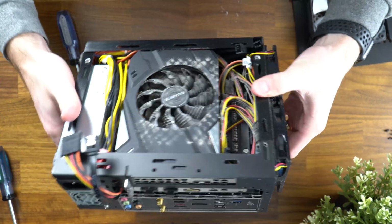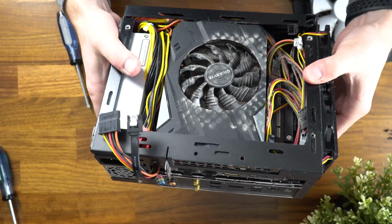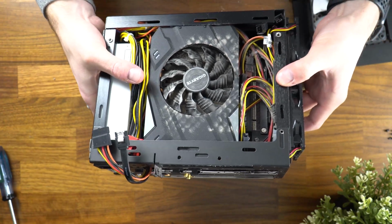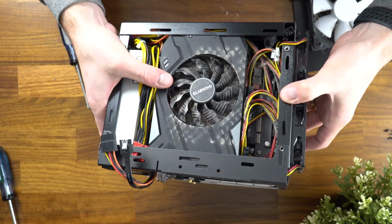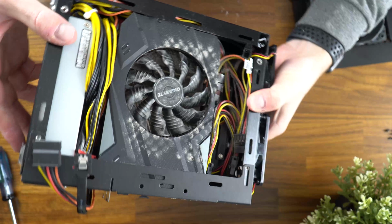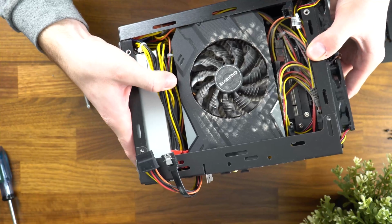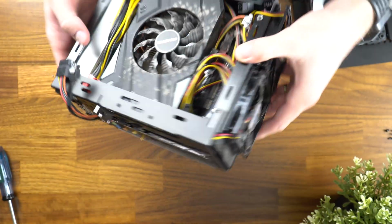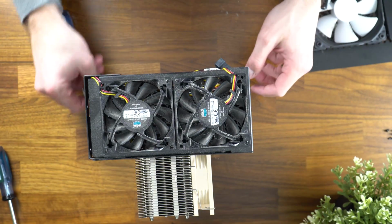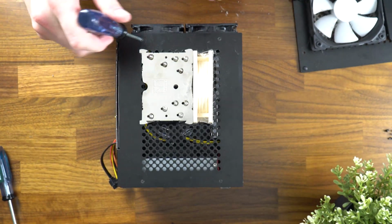All right, now let's switch this over. So here's the top of the case. I'm guessing the dust is worse because I had a fan blowing in to magnify this fan blowing through the radiator. So it's probably worse than it actually would be because of that huge, large fan on the exterior, but all that dust everywhere. See all that on the cables in there as well. But then if you notice, like down here, the dust really isn't too bad. So at least my airflow is working well. I think if you were able to use a bunch of nice screens on the inside of this, it would help tremendously. And if we look at the top here, I'm going to take this panel off.